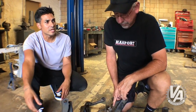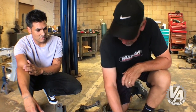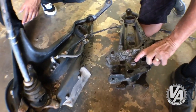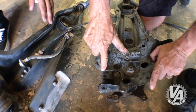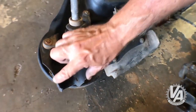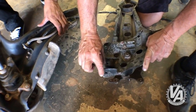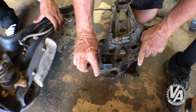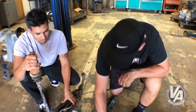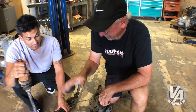So I think that's where you decided you're going to come in and try to do something. A couple things I've noticed right off the bat, just looking at the construction generally — you see where this would be where the axle would be, and you can see it's right in line with the lower control arm. If you look at this one right here, this would be where the center line is — that's quite a bit farther back. So obviously this has been moved back. That means that this rear subframe also brings the lower control arm back, because these control arms are the same: wagon, EF sedan, CRX — they're all the same.